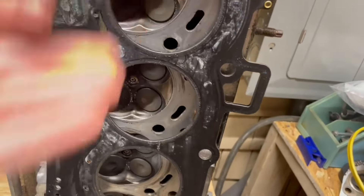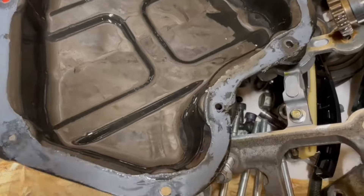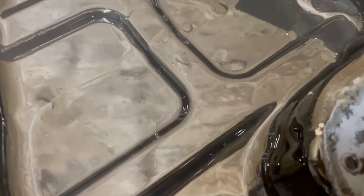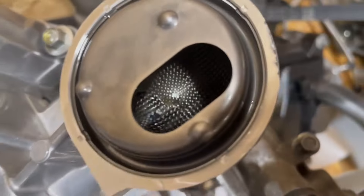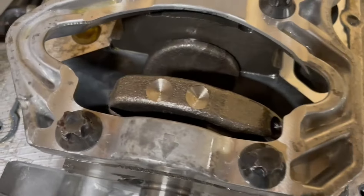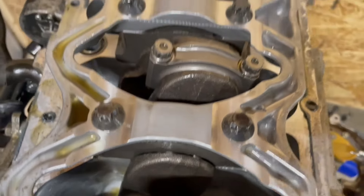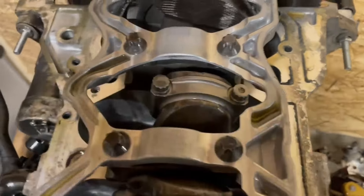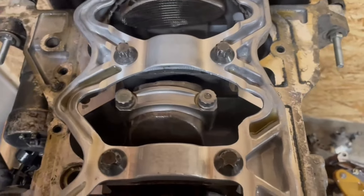The cylinder walls look fine so far, but I've got to wait until I get the bottom half taken apart. We have the lower oil pan and there are definitely bits of the missing tooth, so that verifies that. The oil pump doesn't have any large chunks in it that I can see — I might pull that apart. Upper pan is off and the engine looks immaculate.